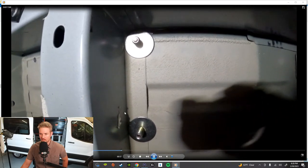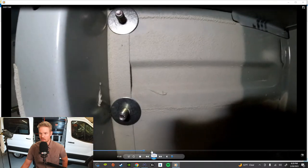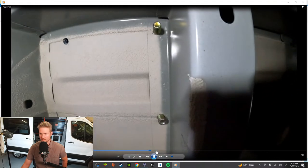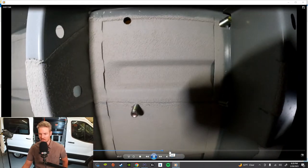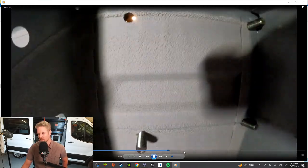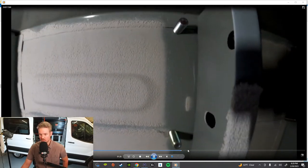We got these — there's the second two bolts, and those are the third row. Then we had that cross member that was still messing with us, and then the back. So really there's no other place to locate this seat with the pre-drilled holes other than this. I would not advise drilling additional holes into that plate for safety's sake. Ideally, we would like to have this corrugation be where the holes are drilled and the seat bolted — it does make a huge difference. That would be best for surface area contact of the seat plate. The bottom of the van — you want the seat in a place where you can access these bolts without having to drop the gas tank or take off the footstep of the van. That's why this location is where it ended up.